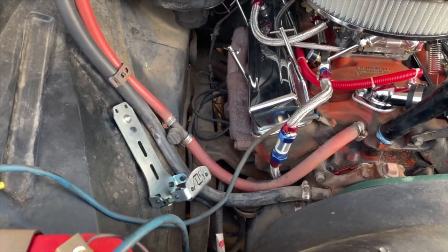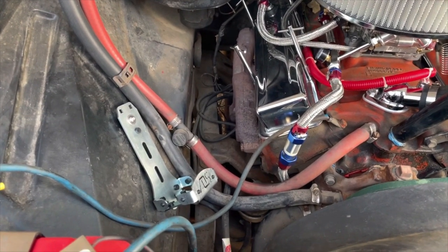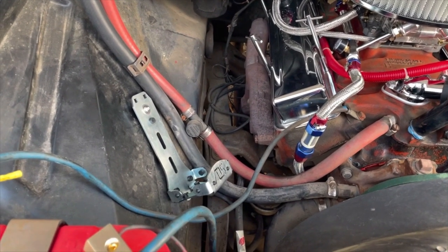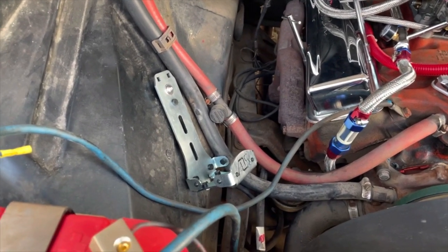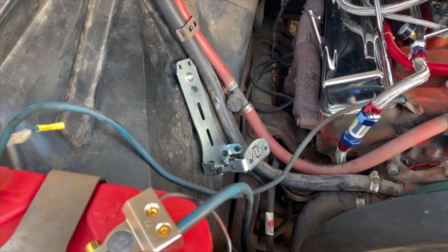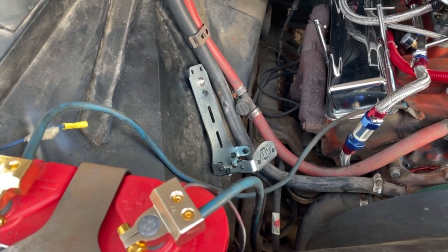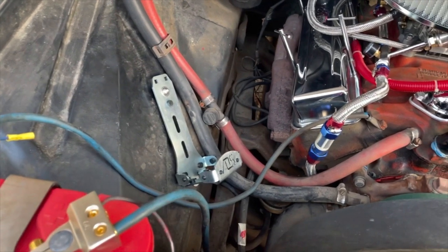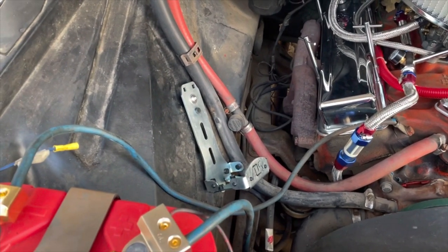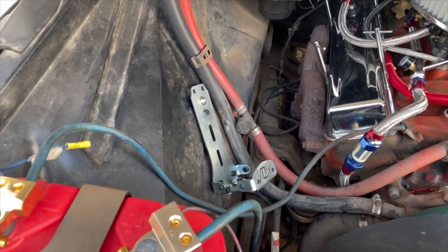And of course we'll put a little coolant in there, and it did recommend that you keep it about 2 inches from the bottom. So I said a half inch earlier, but when going through the instructions, it said 2 inches. But when installing this too, keep in mind that you want to keep it away from heat, because it is glass. But I think where I'm at there should be fine. It's far enough away from the manifolds and everything else. I don't think it'll get hit by rocks or anything. And if so, whatever, we'll get another bottle and keep going.